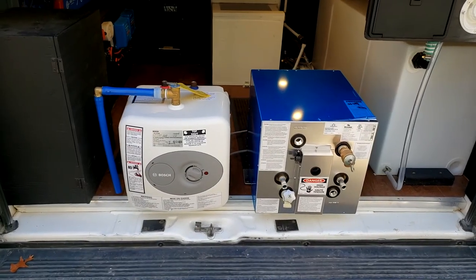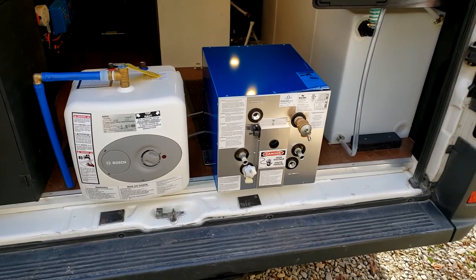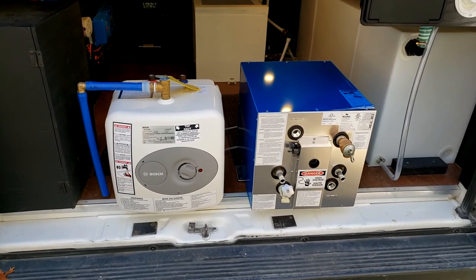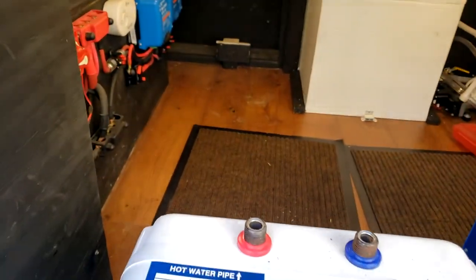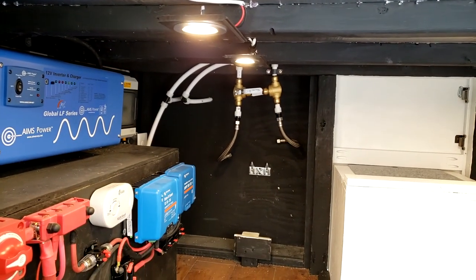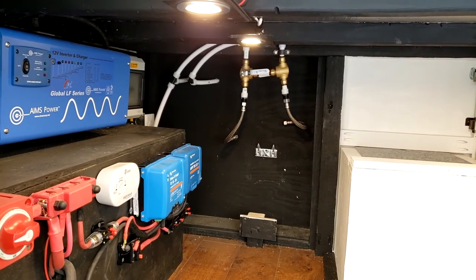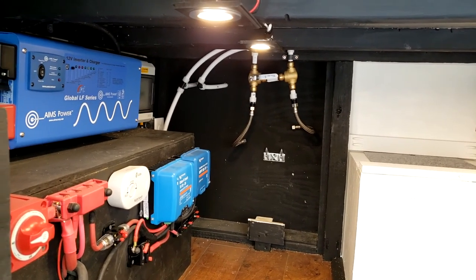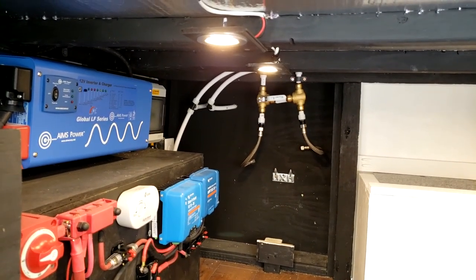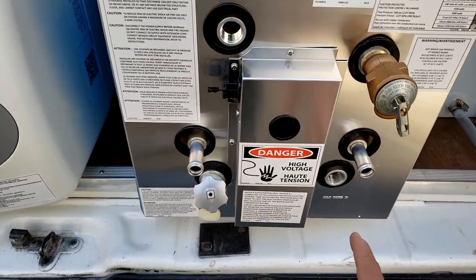All right, so if you're just installing this straight off, you can design where you want it back here. In my case, I'm retrofitting where I already had some plumbing. So there's my little shutoff valves. I'm going to actually remove those and go with a little bit different setup. I won't need the braided lines anymore. I'm going to hardwire the plumbing lines into the front of the unit here. Again, I'll be maintaining PEX lines with some adapters.